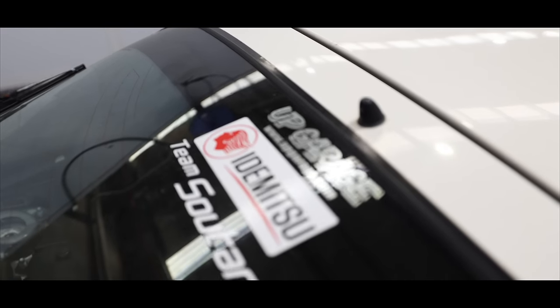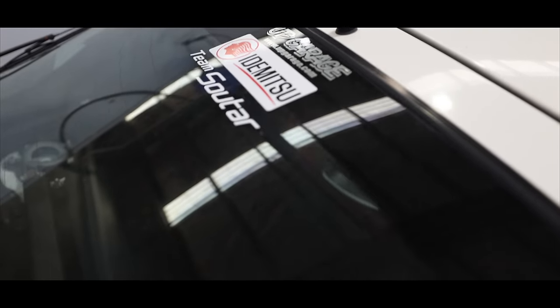On the paint front, based on my inspection and measurements, it's really going to be about restoring and amplifying gloss and then protecting the finish, rather than chasing deeper defects that really isn't going to be possible or even appropriate based on the amount of clear coat available.